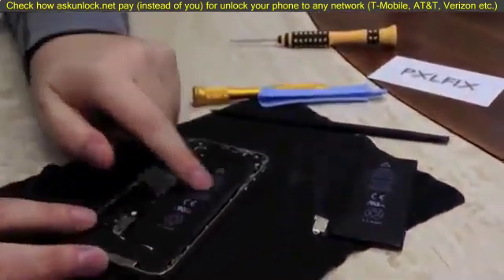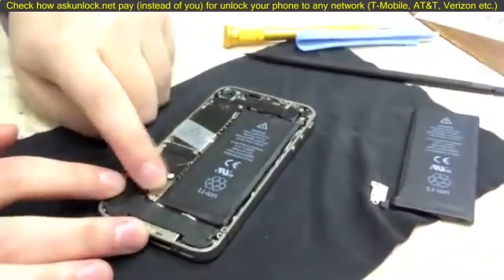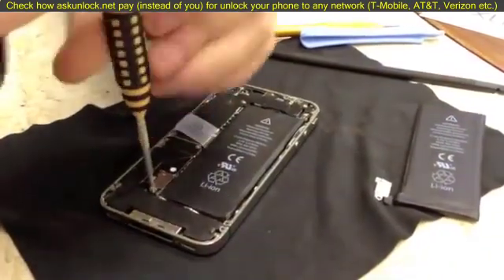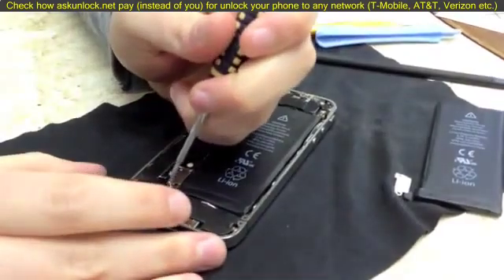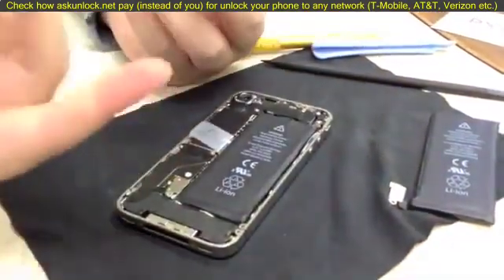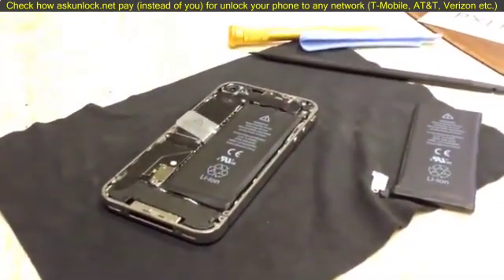Here's your battery right here. There's a screw holding the battery down right here — we're going to remove that. It's a double zero Phillips screw as well. Whenever you're taking these apart you want to keep the screws separate because some of them have different heads and are different lengths. If you mix them up you're going to have a hard time reassembling, so I typically just leave them all separate.